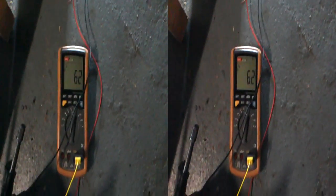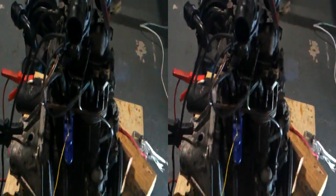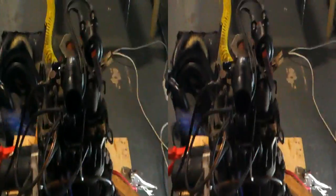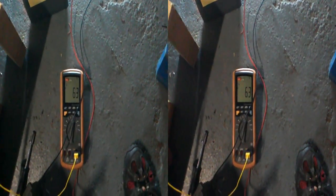Power temperature is 62 degrees. Now that went up to 65, and then I dropped the idle slightly and it dropped down to 62 degrees, so that could quite happily carry on idling like that and it wouldn't damage the engine. It's kind of flicking between — it's not exactly 62.5 obviously.